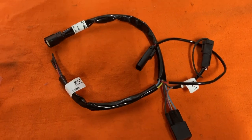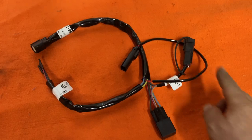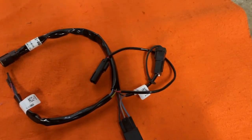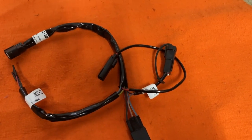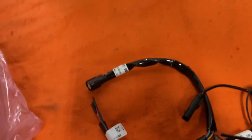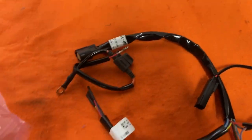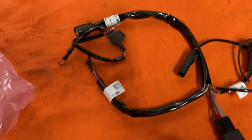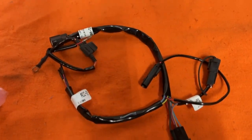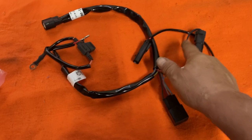You can wire up heated seats, things like this — things you want to wire in. The advantage is the Harley sells a plug that gives you wiring so you can wire up your LED lights and things like this. There's only one other wire that is not included; you have to add it yourself. This one connects directly to the battery and goes to a plug. That way you have direct fuse — it's got a fuse right here — a fused wire to run the accessories through the relay.